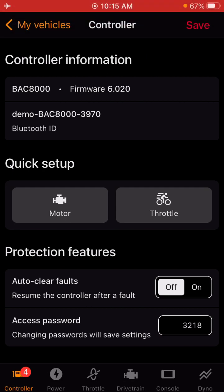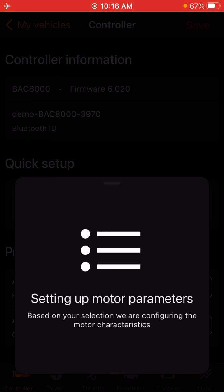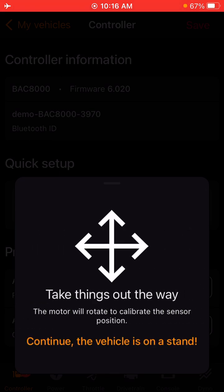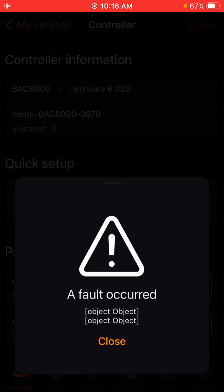You're going to want to run the motor setup wizard. You want to make sure that the bike is on a stand when you run this. It's very simple to use — just select your motor. It's going to rotate the wheel and detect all of the settings of the motor, including your hall sensor settings, how many poles, and so forth.